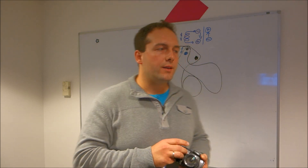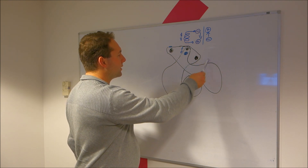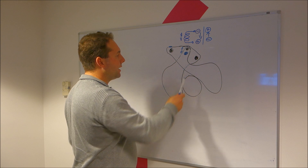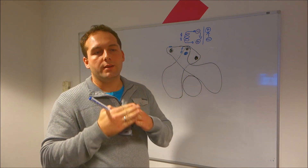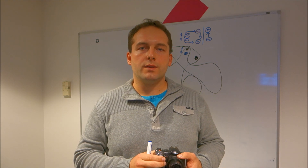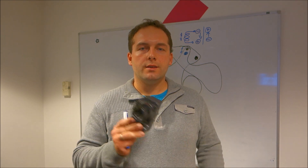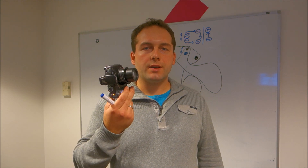—it's called the shutter group for this camera. I had a bad, contaminated part: it had oil contamination, and oil from the servo motor gets between the blades and they stick together. There's also a method in the video I mentioned — it should be in the description — showing how to clean it, which is what I did.